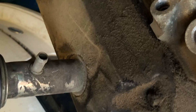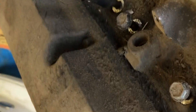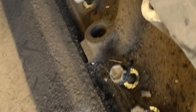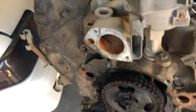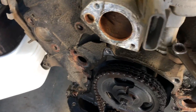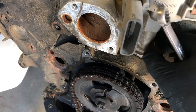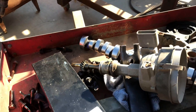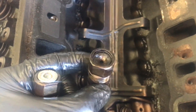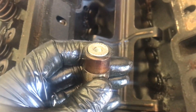We're going to get the intake manifold off and get that screw out. To check piston to valve clearance on the stock cam, we've gotten rid of the factory hydraulic roller lifter because sometimes that will depress even with the light checker springs we have. So Mark whipped up this solid roller setup to minimize deflection and make sure that our testing is all accurate.